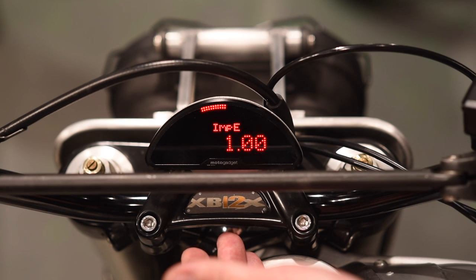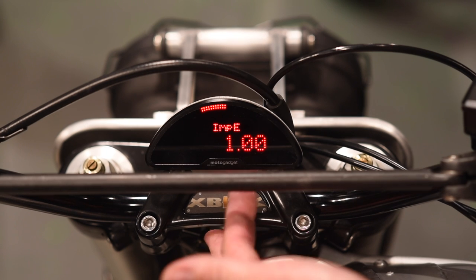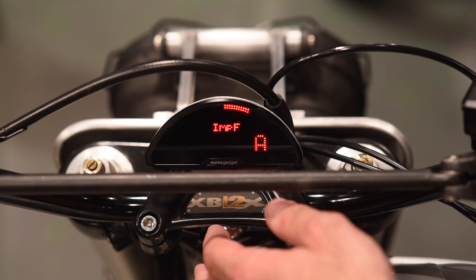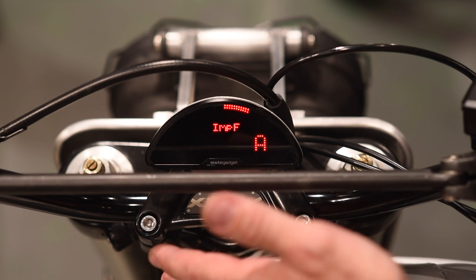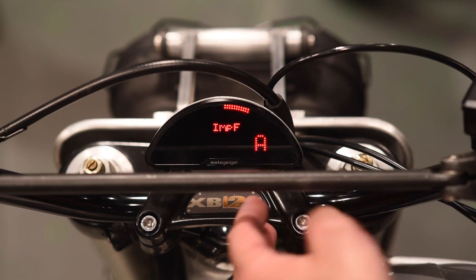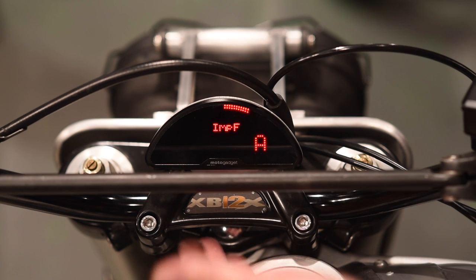A practical approach: just pick one setting and see if the RPM looks right. Most bikes idle at about 1,000 RPM, so if it's reading 2,000 at idle your calibration is wrong — go change it. You're not going to hurt anything; it's just going to read inaccurately until you adjust it. Next is impulse F, which means filter. If your tach is configured correctly but reads a little jumpy or erratic, these filtering algorithms — A, B, C, and D — let you try different options. There's not much documentation on the differences; just try one and see if it works better.